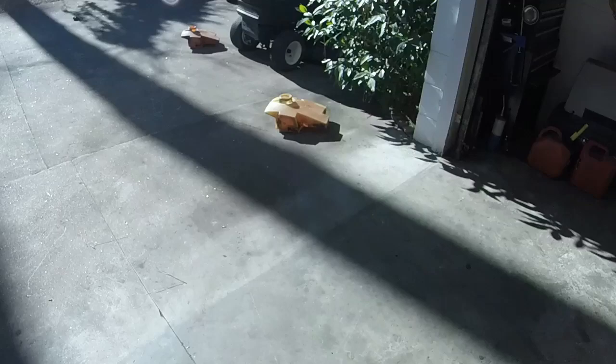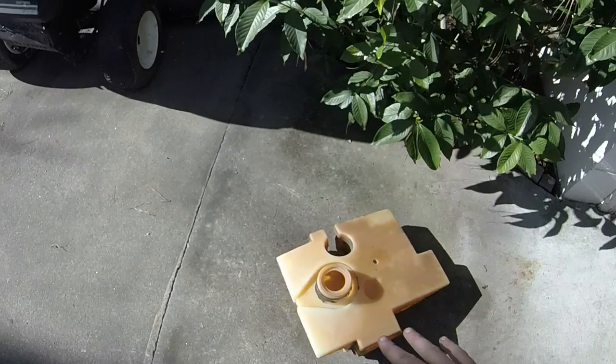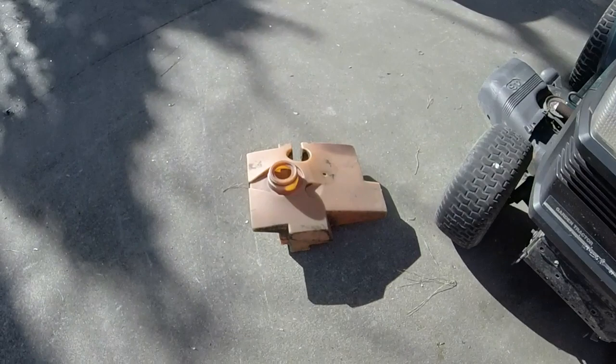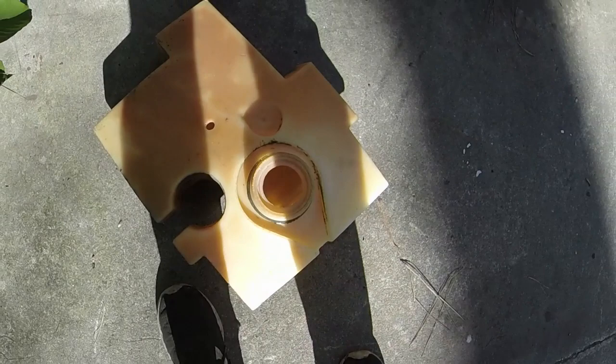And gas tank wise, one other thing I wanted to touch on, I did my best to clean these tanks, but my small pressure washer bit the dust, so I had to use the big one. And this thing right here will run all over the place. So I got at least the top portion of it clean. There's not gonna be any dirt or contaminants getting in it from the top. This is the one that came out of it. It was dirtier than the one that was on the 178. So I'm just gonna pop the 178 gas tank in. Your fuel grommet goes right there. Obviously gas cap goes right there and it sits in the back.